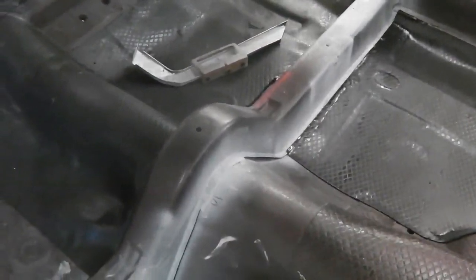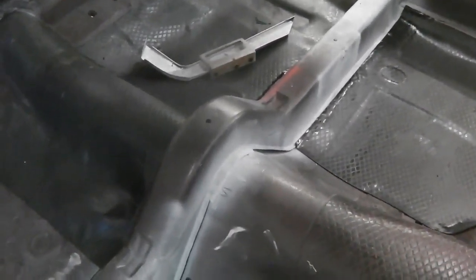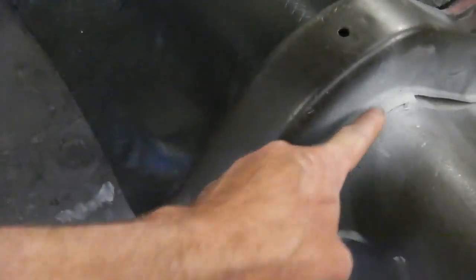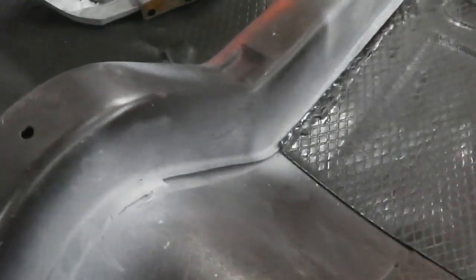Again, another full day on it. Surprised how long the crossmember took, just to prep, clean, prime, then plug weld, grind back, and then I even dolphin filled in the plugs, so it was a very nice run. You can just see we skimmed in them plugs, so you get a smooth finish. Indeed, that's reflected in the fact when the sound pads go over, they leave a smooth line rather than any rough welds or indentations. So just a little bit of detailing there for the sound pads.